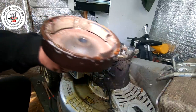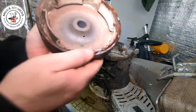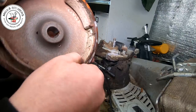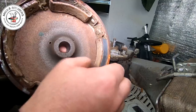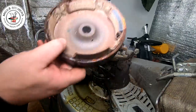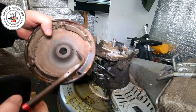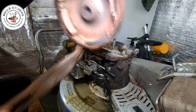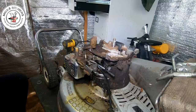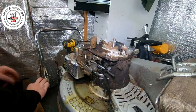Here's all my magnets and flywheel, and as you can see there's lots of debris in here built up over the years. That magnet there I dare say is not doing a great deal — it is cleaning off. The magnet is actually behind there — there it is — and as you can see there's lots of debris in there, so that's getting cleaned off with a wire brush before we do anything else.